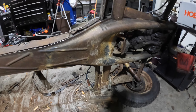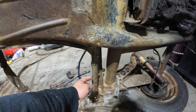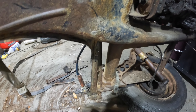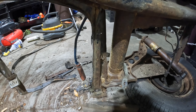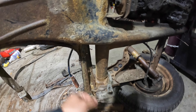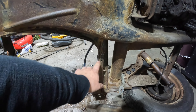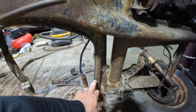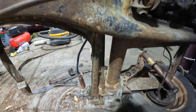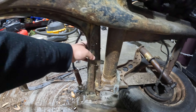We got the passenger side pan cut out. I want to show this part because the last set of pans we did came with the rear body brace, so that's going to be a little different on these ones. The Wolfsburg West pans, as you can see, don't have the body brace, which I think I'm starting to like. We're going to wire wheel this just to reveal the spot welds — you can already see them a bit — then drill them out. That way we can leave this part here and just weld the new pans to it.